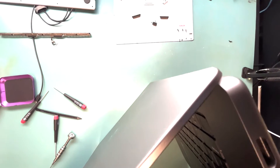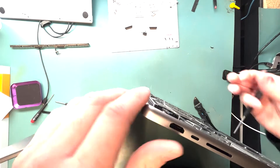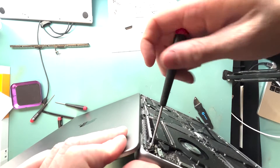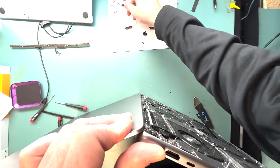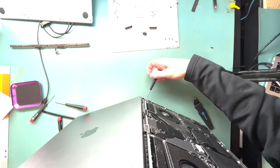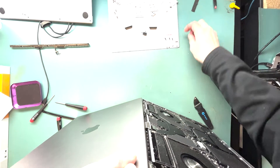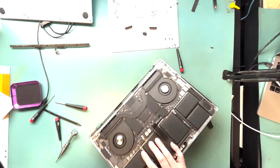Zoom the camera out to get a good view: lift the laptop up and lay it on its side with the screen opened, then remove those final T8 screws from the hinge. Then just push the screen off away from the top case — and the screen is removed. Prep the new screen by using pliers to bend the hinges back into the open state.